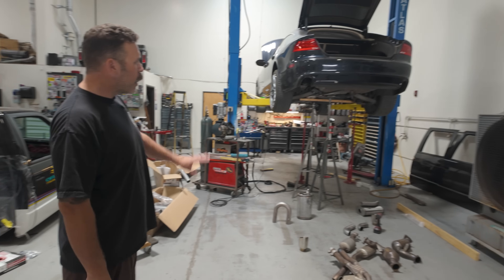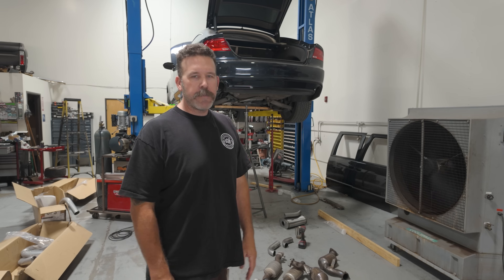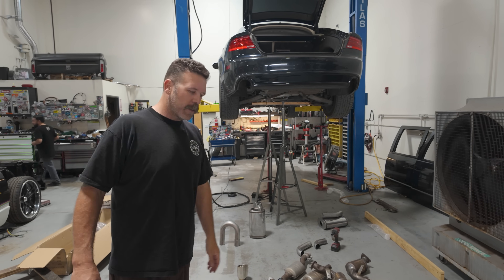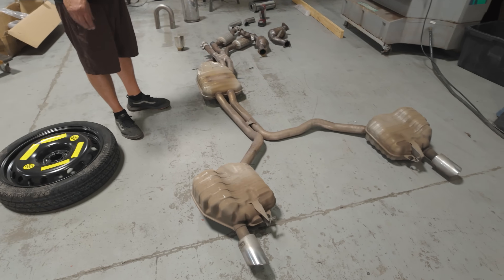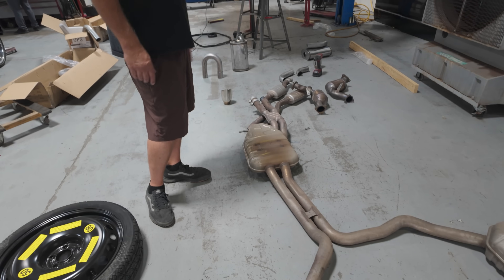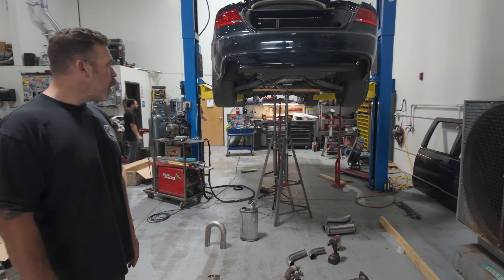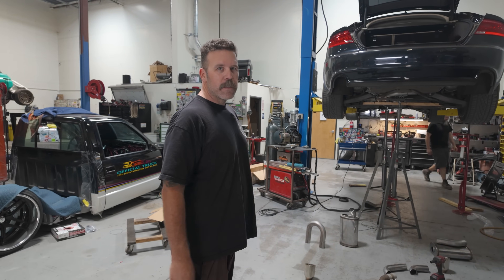Alright, you want to look at the car? This is my Audi, this is what I drive almost every day. I've already got too many miles on my diesel, so I bought this like a year ago. Just like anything, you can't leave it alone. Right when I first got it I did a bigger heat exchanger, a bigger crank pulley, and the tuning and everything to make this car faster than it already was. I bought an exhaust kit, had mufflers laying around, bought another muffler with a little X-pipe built into it. But these cars are known for rasping and I don't want rasp. So right now there's three mufflers and four cats on it. We're going to go to just three mufflers and no cats, because the supercharger with the bigger pulley is known to blow out the material in the cats. Trying to knock out an exhaust on this thing today — quick, dirty, drive it every day. But maybe now it'll be even faster.